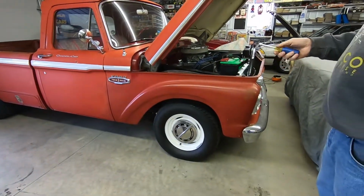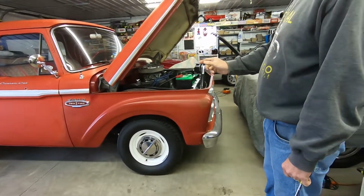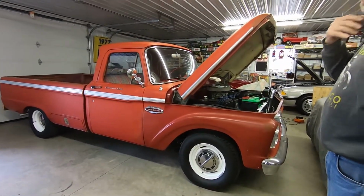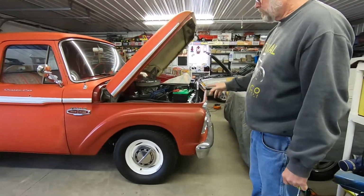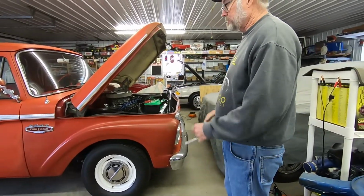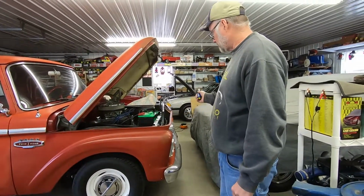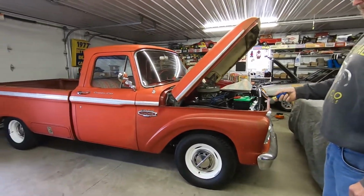They're '68 brakes, which are a bigger drum. The '66s had real narrow drums. The '68s have 3-inch drums. The factory ones are not much bigger, and it's on the '65. So we put them on, and then I actually put the whole front end from a '68, the I-beams and all, in it, and then put all new brakes in it, and put '91 Explorer front springs in it.